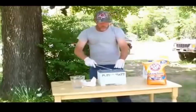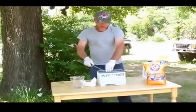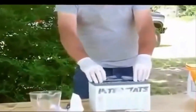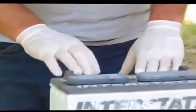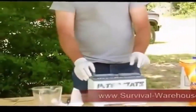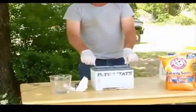Always remember when you're charging a battery, pop the caps and let them sit loosely because charging does create gas. For safety reasons, just lightly place the caps on there and charge it slowly. This will take approximately 24 to 36 hours. Once it's charged 100%, you can set it aside for a day and test it to make sure it's holding a charge.